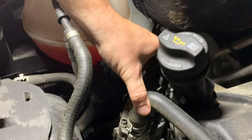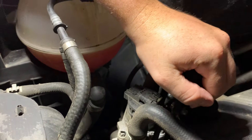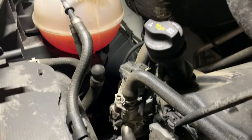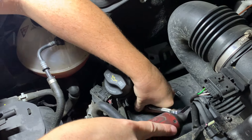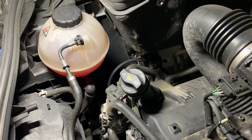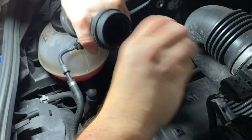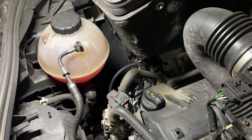You've got your EGR valve right here. It's got two hoses connected to it and one electrical connector. You have to move the fill tube for the oil first — that's an E10. Pop that out, swing it out of the way, take the cap off and pop it back on. It just kind of cuts down on any debris.